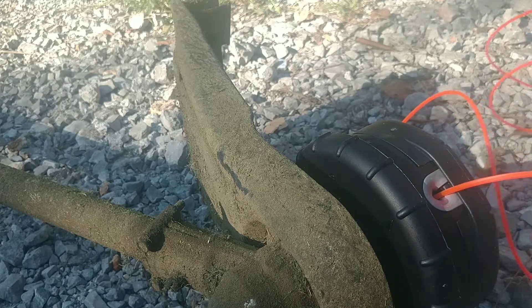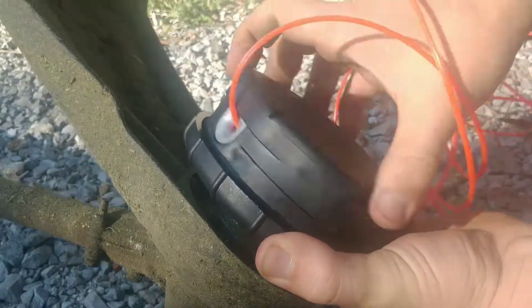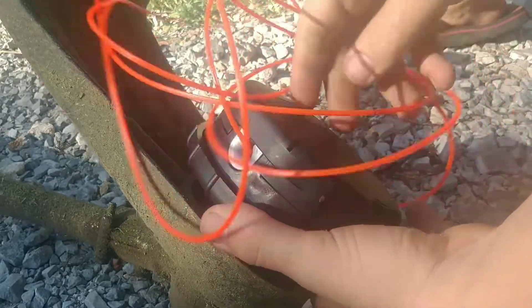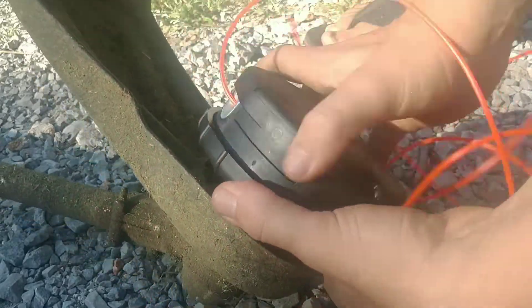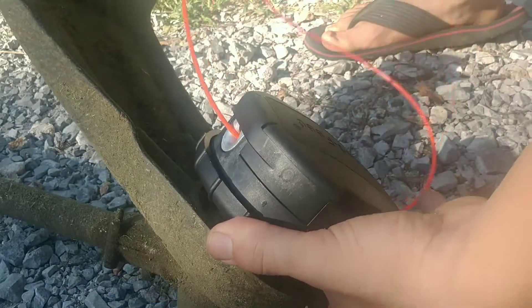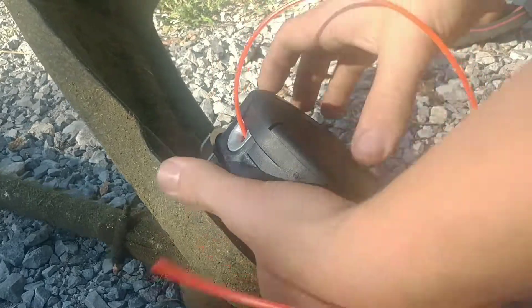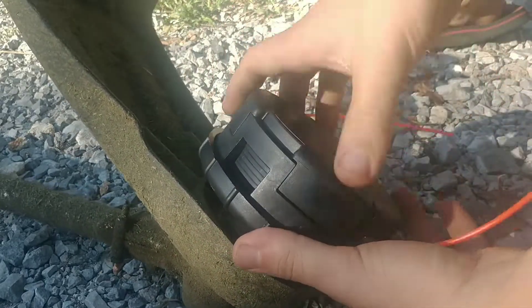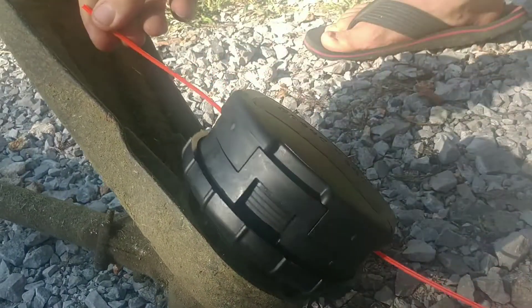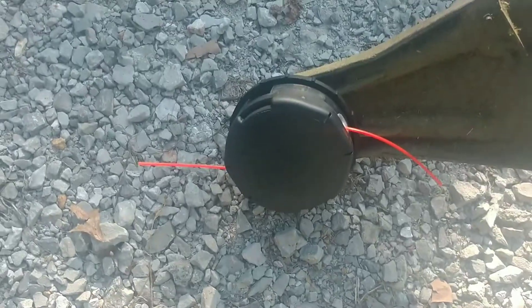Walk the string down and make sure both pieces are even. Then grab the string, give it a few clicks, and start spinning — that's the speed feed feature. Just like that. This is why I like the Echo. This video isn't sponsored by the way — all these parts I bought myself. That's how I do it. Thanks for watching and stay tuned for more.